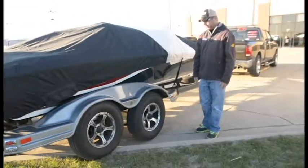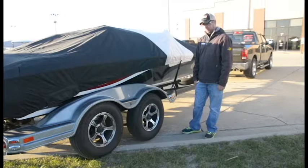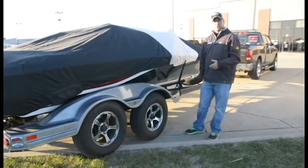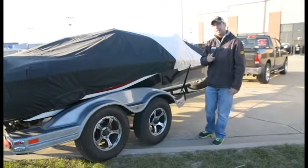As you'll notice now, everything's completely free-spinning, nice and easy, so you can get that tire off, get the new one on, and get rolling down the road. Also, when you go back off the curb, make sure to take it slow. I always recommend anytime you're up in this position, make sure you go ahead and lock that parking brake.